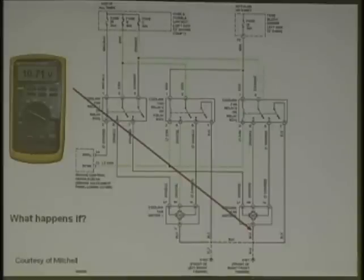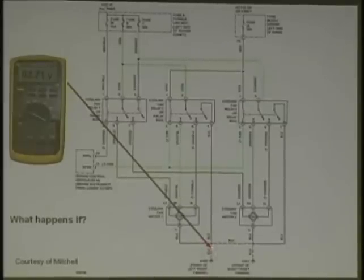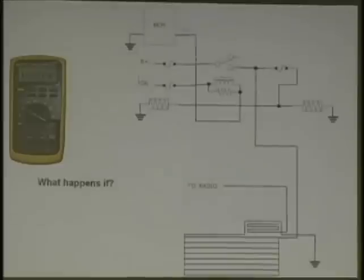Because again, look at this. There's a whole bunch of other things, and if that's the only circuit, that's the little kick. A lot of times at splices, one wire might corrode right off. We've got another one, 2.71 volts. What is that going to affect? It may affect multiple things on a car, wouldn't it? Why? We already told you there are multiple grounds to that. Okay, let's move on. I think they got the idea.